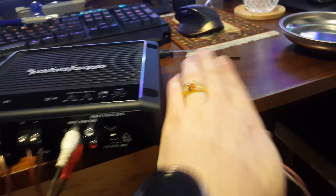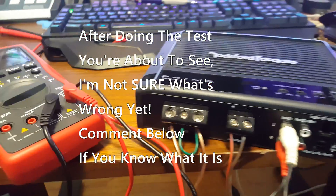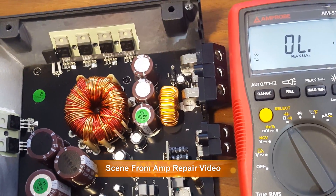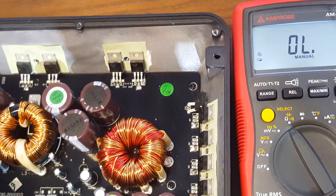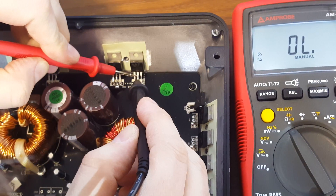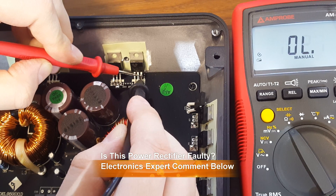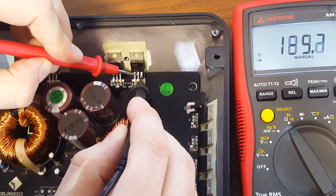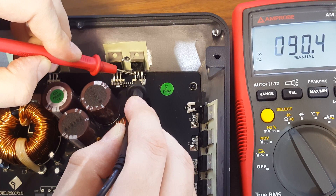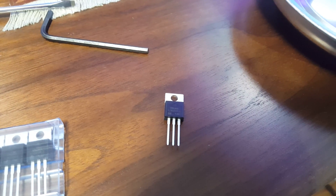This is just a little update. I was working on a totally different video — I took this whole amp apart, tested all the MOSFETs, and found what I thought was one of the power rectifiers shorted out, which I was getting ready to solder. Just to confirm, let's confirm we have the short where we think we have it: one probe here, one probe in the middle — and there you go.